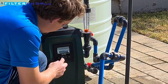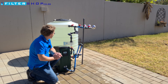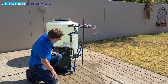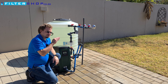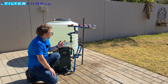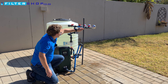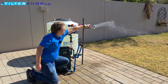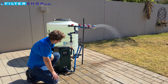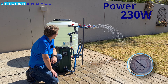Setting it to two bar, we can see how low we can get this unit's power consumption. It's definitely got a bigger tank than the EasyBox Mini. On the Mini when you open you'd notice a dip in flow as the tank gets empty — this one the first release actually just came from the tank before the unit started. At two bar with just a small amount of flow, it's actually only drawing 230 watts, which is very impressive.